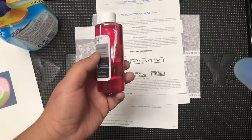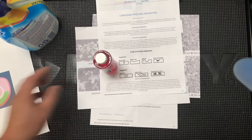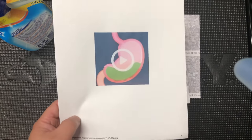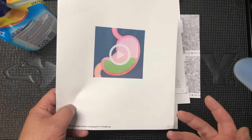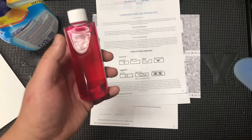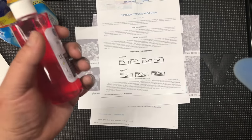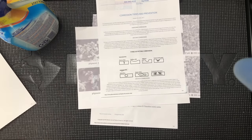The red cleaning solution has corrosive agents, but also many counter-corrosive protective agents, as well as a group of surfactants. The process is like you line your stomach with Pepto, then you can drink alcohol. The process is what we call a controlled corrosion. When it is used properly, only the ink will be affected and the printhead will be safe. The protective agents will coat the printhead and prevent the printhead from damage.